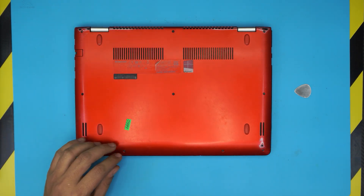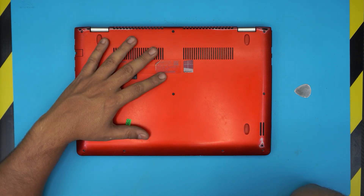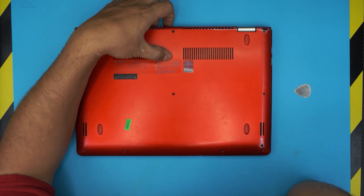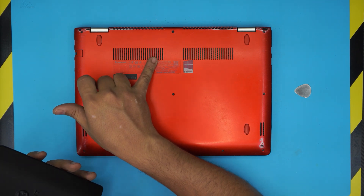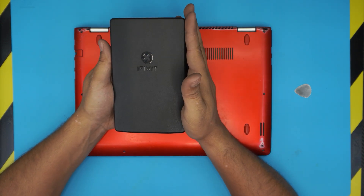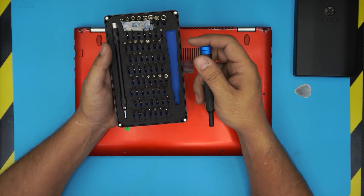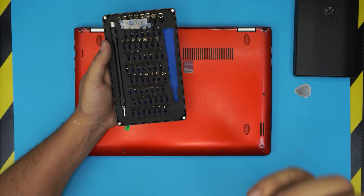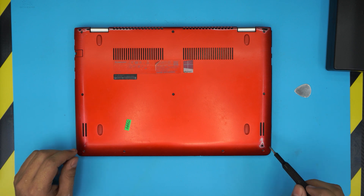Let's keep this video short and get into the service. First thing: flip your laptop over and put the bottom cover facing up. The exact model is a Yoga 500-14, and there's a model name that says ADN4. You'll want to grab yourself an opening tool — I use the iFixit toolset, which has all the bits you need for any laptop, iPhone, or other cell phone you're trying to open. We're going to be using a Phillips number zero from this set.